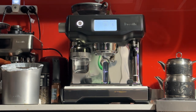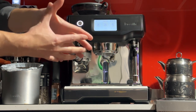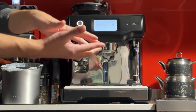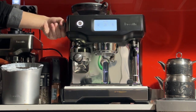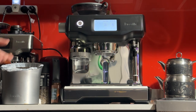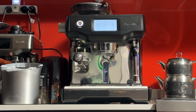Two things about the grind size. Firstly, I would highly recommend you only change the grind size with the grinder grinding. You don't want to do any damage to the burrs, especially if you're going finer. If the burrs aren't moving and it's not grinding, they just smash each other with beans in between, which puts a lot of stress on the mechanism. So start grinding, wait for it to grind, and then adjust. After you've arrived at that preferred grind size — in my case 15 — keep it running for another two seconds to get rid of the old grind size, as there are a couple of grams in the chute from the older setting.